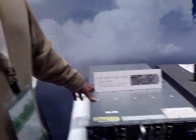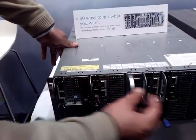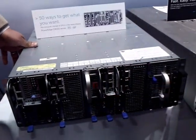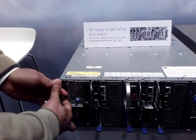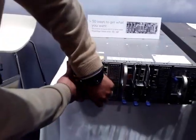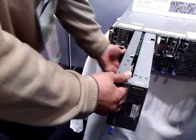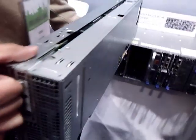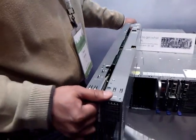This differentiates in a way in that, in the spirit of disaggregation, we're able to utilize purpose-built sleds, whether it's single-wide or double-wide. If you put the camera here, I could show you how I can manipulate the mechanicals. This section here shows double-wide sleds. These blue release handles are actually the release mechanisms to release what is the smallest unit of compute. Once you release this tab, this entire unit actually releases itself from the chassis — this is what we call a sled.